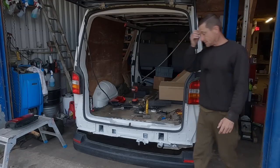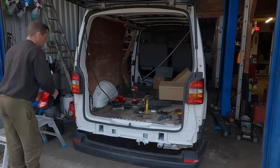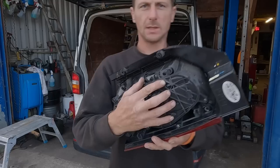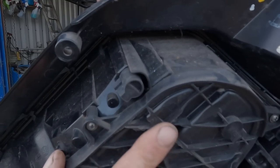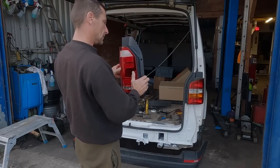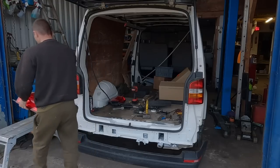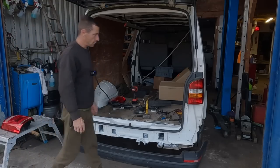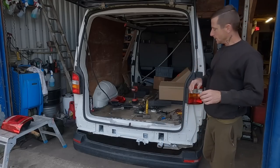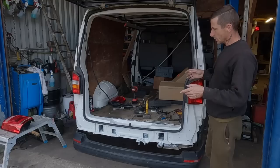I've tried the lights in — we know they fit against the tailgate. When I put the lights in they ever so slightly pushed out a little bit, so I shaved down a tiny little piece of plastic right here. That way when I put the lights on I haven't got to force them in to get the screws in. I'll get the camera set up better. I've got a guide on the internet — I'll put a picture up. We're going to de-pin all the wires, poke them in the right spots, and try them.